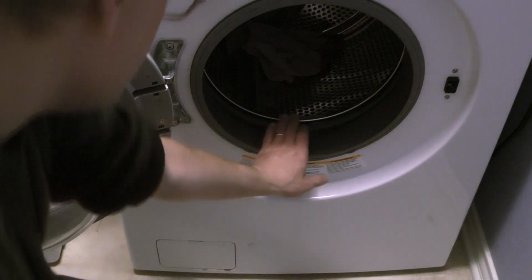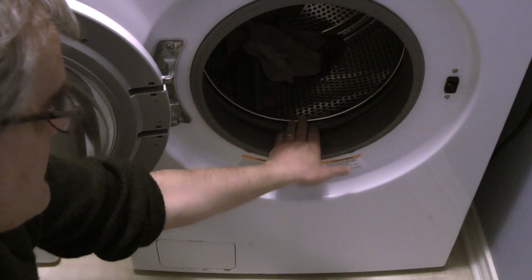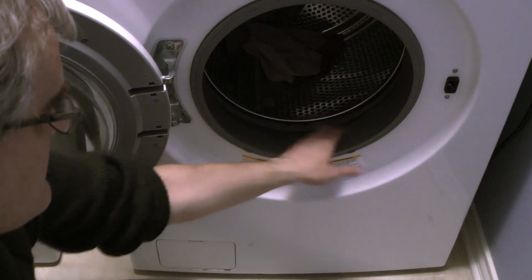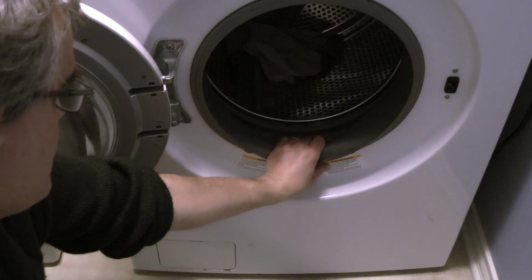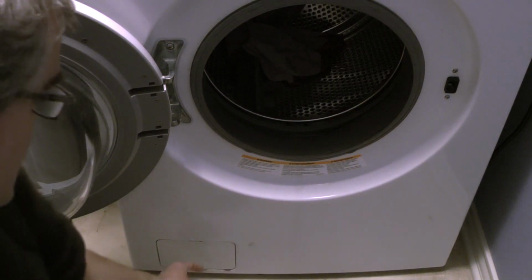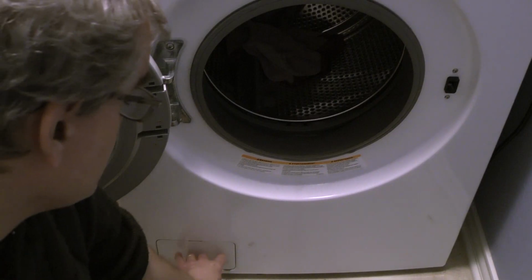Let's go. Just to give you a visual, there is the gasket here, and this usually accumulates a lot of water, and it can get pretty nasty over time. That's why you need to dry out the machine, but there's always still water in here. So over the last few years we started drying here, but I guess this rubber ended up getting dislodged or burst somehow. So I'm going to replace that. That's the piece that is going to be replaced. And initially I thought it was on the outlet of the sewer system, but it isn't. So everything's all right on this part of it.